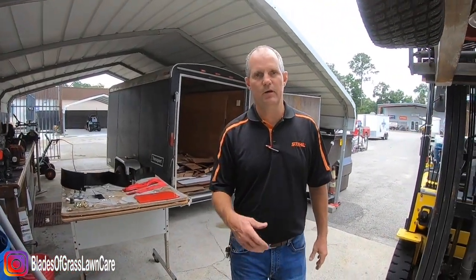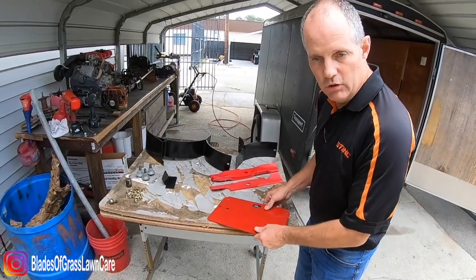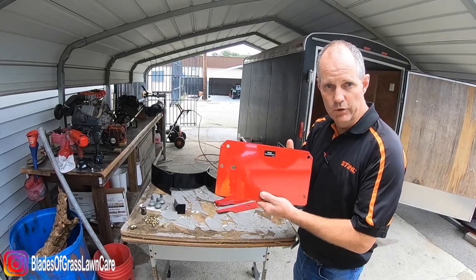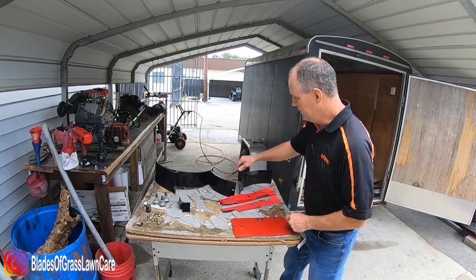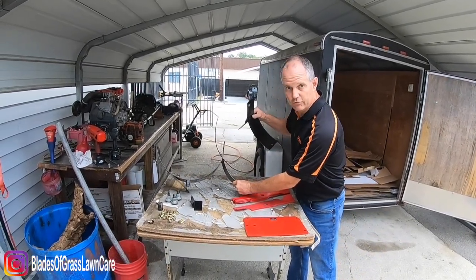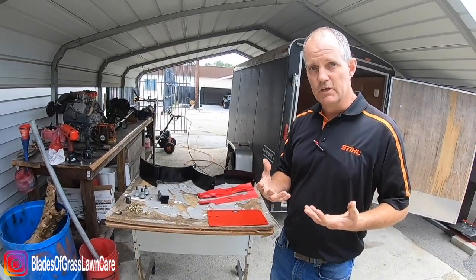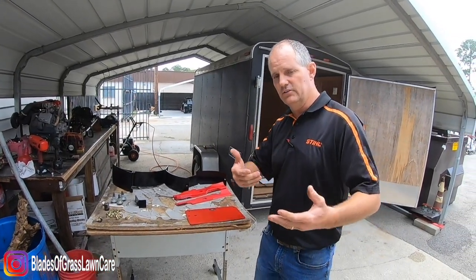Yeah, Johnny. Hey, everybody, we get a lot of customers that come in thinking, I want to mulch, just give me a set of mulching blades. But that really won't do anything different. Let me show you the pieces that make up a mulch kit. Most people want to buy a plate to put on the side discharge of the mower, which will block material from coming out, but it doesn't effectively mulch. A mulching kit is a series of baffles that bolt underneath the deck to keep the material around each blade. So it's cutting multiple times over and over again, and doesn't discharge to the next blade and then out.